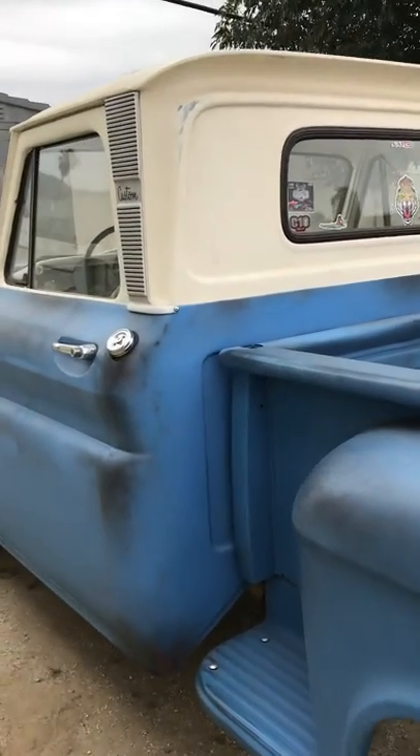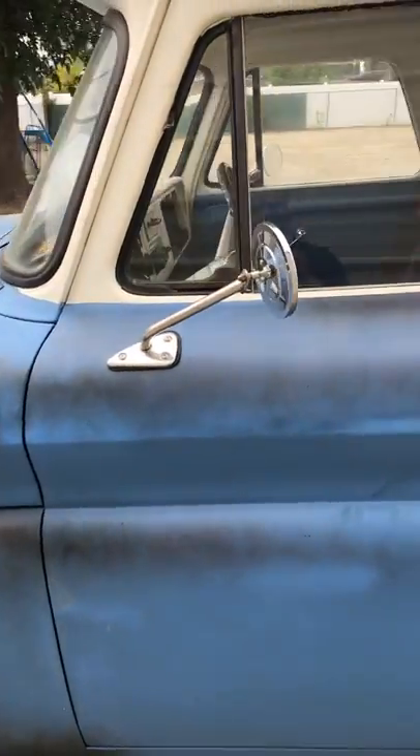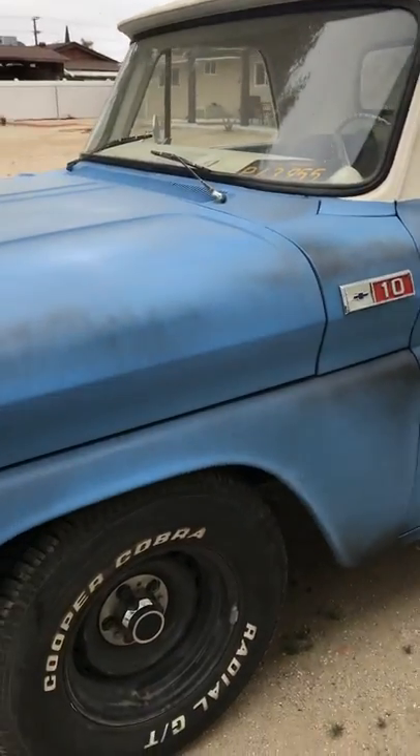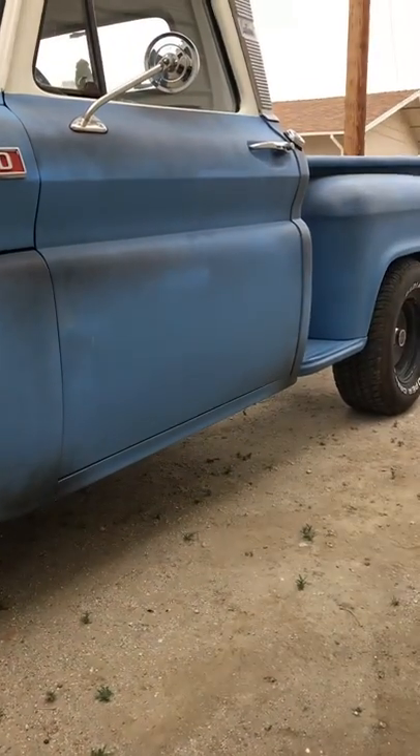Like I said it's got a lot going for it. They did the five-lug conversion and the disc brake conversion in the front. I've got to finish it up a little bit because they had a power booster in here already but it was set up for drum and drum — drum in the front and drum in the back.